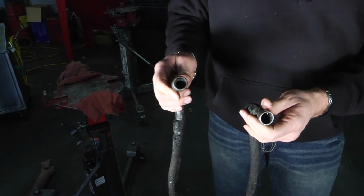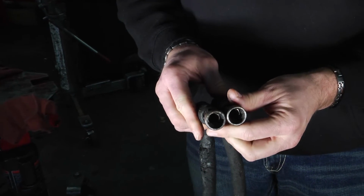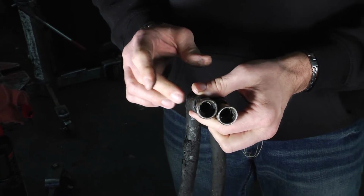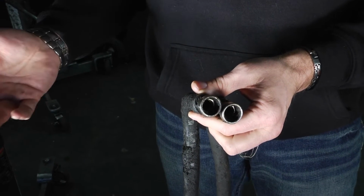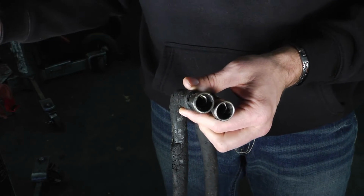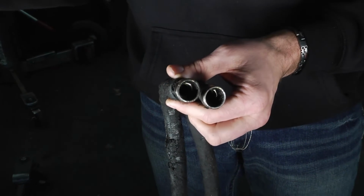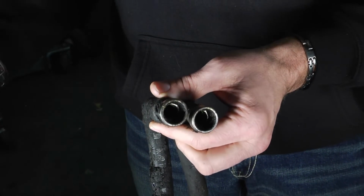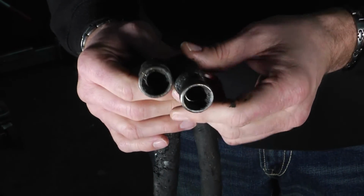Wipe them down and make sure that you don't have any leakage, because we often see a cooler line may not be leaking when the vehicle comes in. You take it off, you manipulate that cooler line around a little bit, you move it, and all of a sudden you hook things back up, and quite often you have a small drip up to a very large leak.